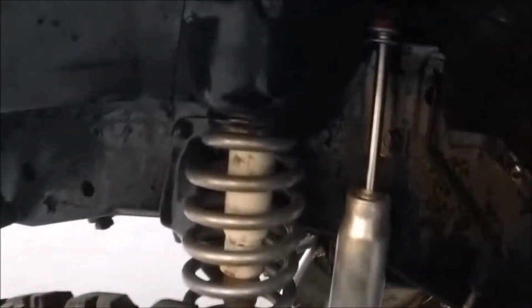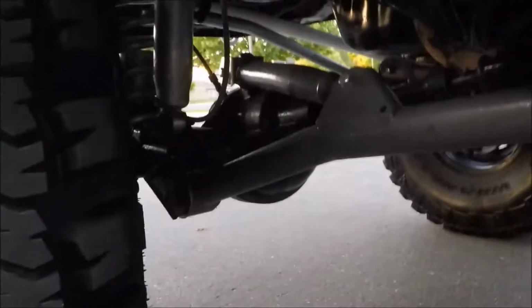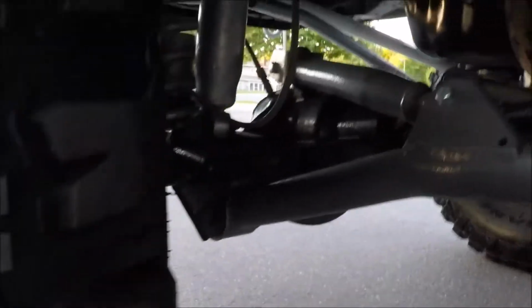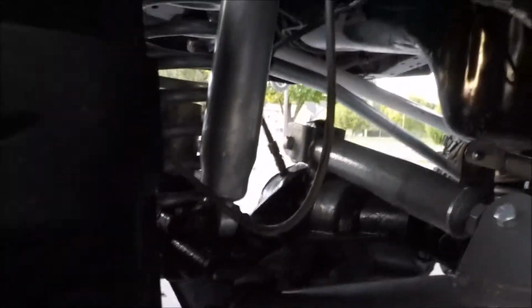Big majority of the stuff on the Jeep is all new. Let's see, we got Rubicon Express. We got long arms, full long arms for the front suspension. The heavy-duty cross member. This is super beefy, all new. Got steel braided brake lines. It's also got bar pin eliminators up here to convert the shock mounts.